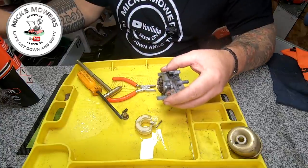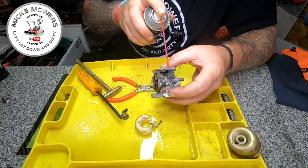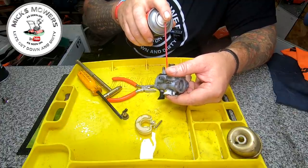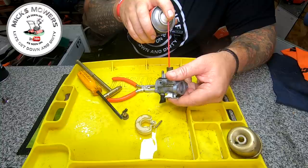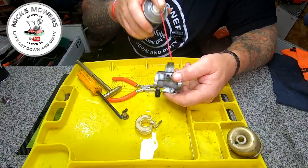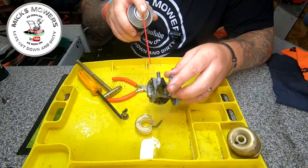That's coming out of there. One in there — that's coming out of the top of the tube. Turn it round, in there, down through there, through the seat. I can see it there through the tube, through the emulsion. Both of those. One just in there, and you've got two holes — one here, coming out the front of the jet. And that's pretty much it — that's all you have to do.